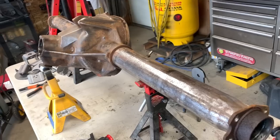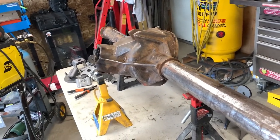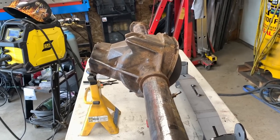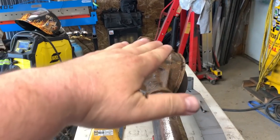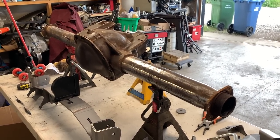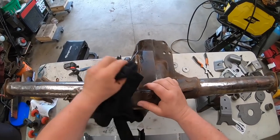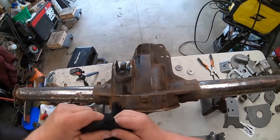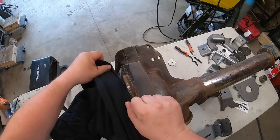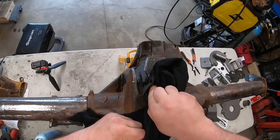The deal behind this is: set your pinion degree roughly where it's going to be, put your truss on flat — that makes your spring perches right where they need to be cut. Let's just kind of fit this up. Spray that with non-chlorinated brake cleaner, which is very important if you're going to do any welding. If you're using chlorinated brake cleaner, there's a good chance you may kill yourself in the process.